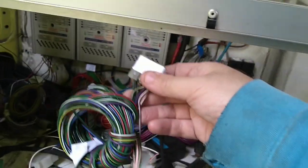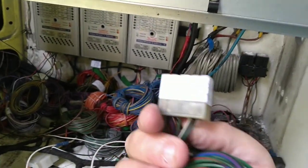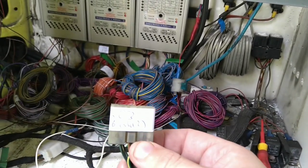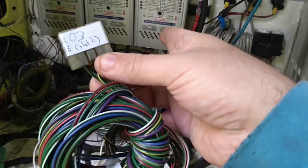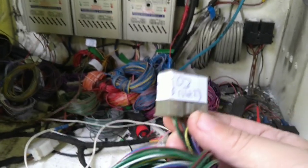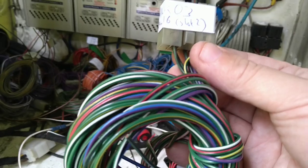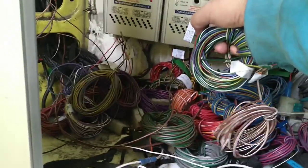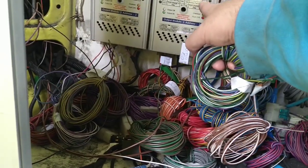One of them we actually managed to remove completely. That was Genesis unit bank 3 — output module 3, slots 9 to 16 — going into that one there. So that was all my spotlights, roof lamps, extractor fans, that sort of stuff. We traced it back and made sure we knew which one was which.